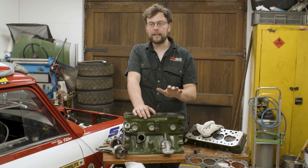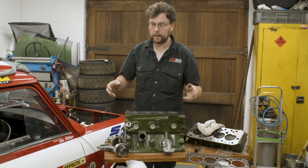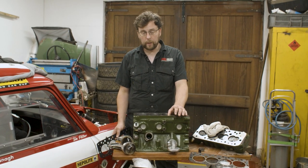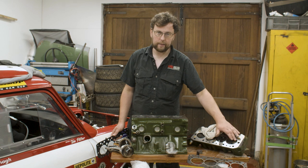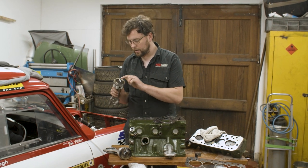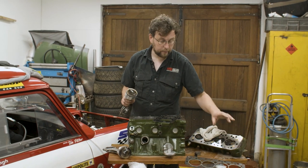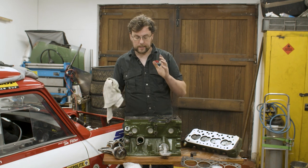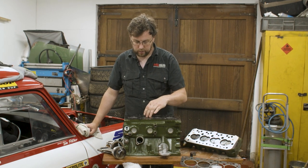You would want to be absolutely sure that every other specification in your engine is on point and completely safe before introducing a gasket like that — then you'd know you're not worried about fueling or ignition or any of those. I'm happy to use one on this race engine because it has gone through a couple of dyno sessions, done some time on track, and the fueling is spot on. The pistons came out looking absolutely perfect with no signs of detonation, no signs of too much compression, a lovely colour on top showing the fueling is exactly right, and the engine was running cool. The setup of this motor is perfect.